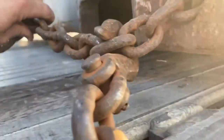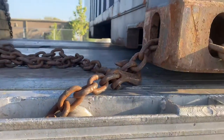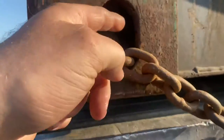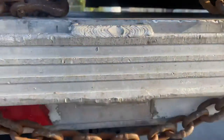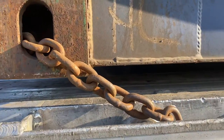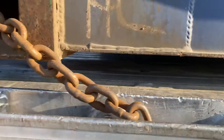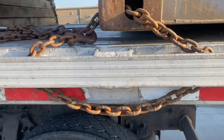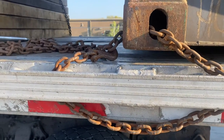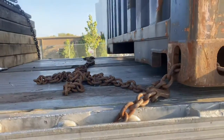Keep in mind that you're going to be throwing your chain across to the other side of the trailer. Make sure when you're routing your chains you come in from the front, come out to the side, go down through the rub rail, and back around. If the container slips back a little bit, it's simpler to go through two of the round posts. Go ahead and throw the chain across and latch it on the opposite side.